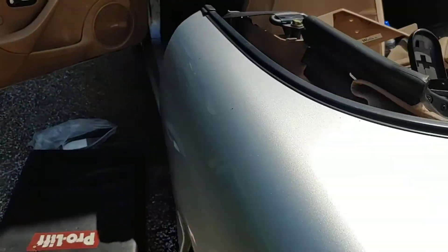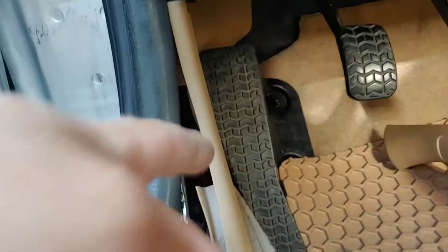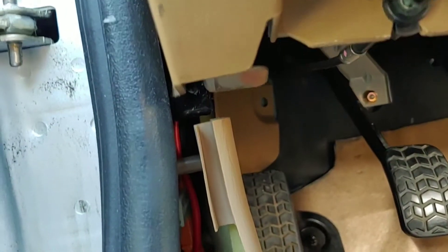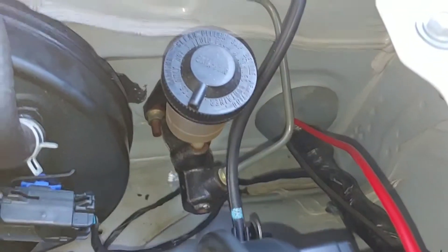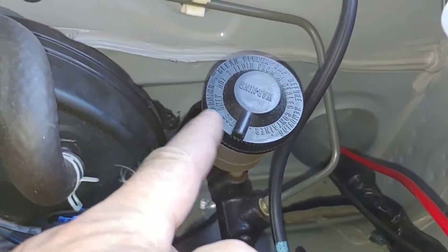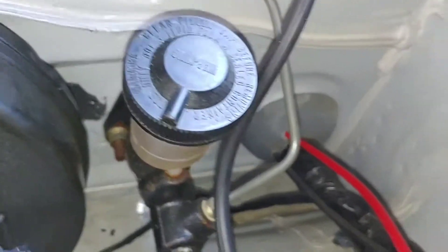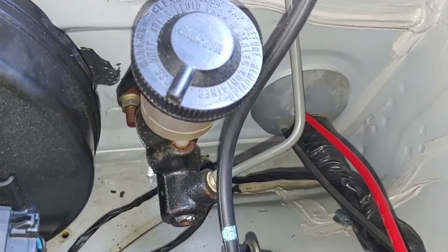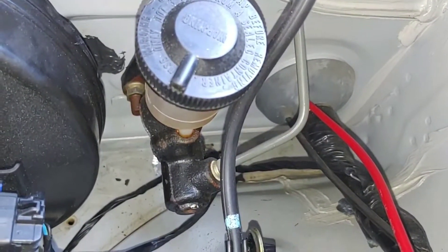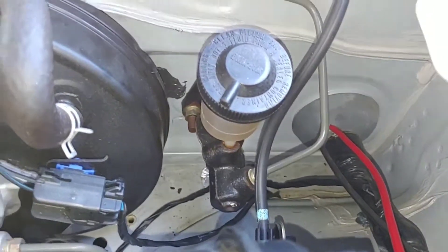Got all that, then I moved forward, pushed up in there — and that's where it got difficult. Let me show you something in the engine compartment. This is the master cylinder for the clutch. There's the main wiring harness and there's a pass-through grommet. What I did is from the other side I used a hanger, tied the wire to it, and pushed through.